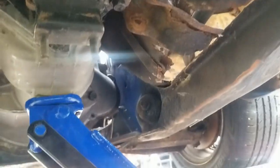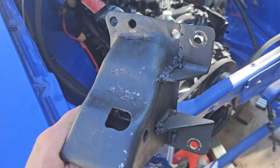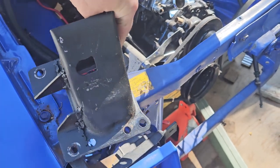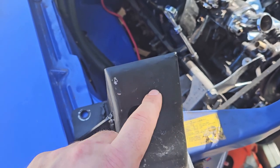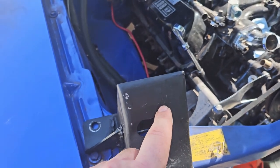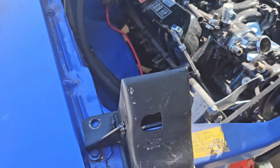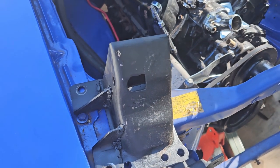Maybe we'll go up through the shifter boot hole to hold it up so I can put my jack back in the garage. Here's the frame mount — my custom one-inch setback Pinto mount. You can see evidence of some marring here, and it looks like the head of that bolt on the rebuilt Mustang II mounts left an impression, so that was hitting and not letting me line up my bolt hole well enough to get the bolt in — binding everything up.